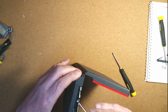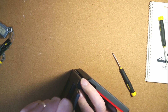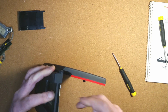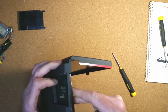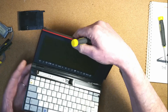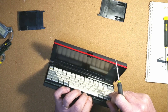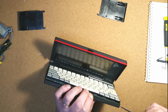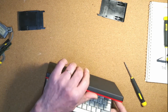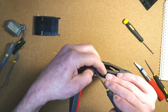I found that whereas the tool of choice when prying apart plastic components would ordinarily be a spudger so as not to leave marks or gouges, in this case the only tool which will exert sufficient force is a small screwdriver. Handled carefully, however, it should be possible to avoid marking the case. Insert the blade between the lip of the lower case and the edge of the keyboard and start to pry it apart until you feel a distinct crack, then work the blade around the case until you've broken all the welds.